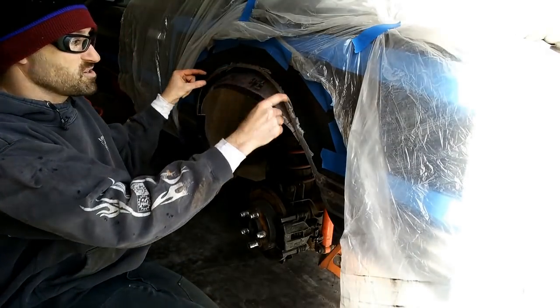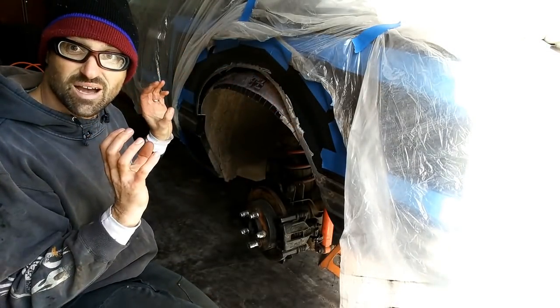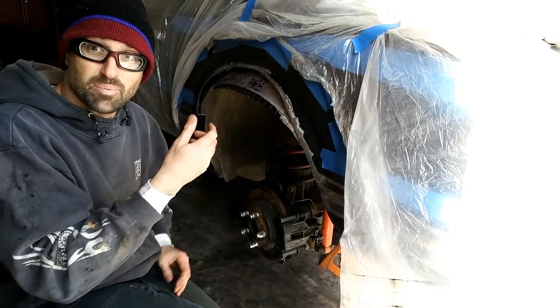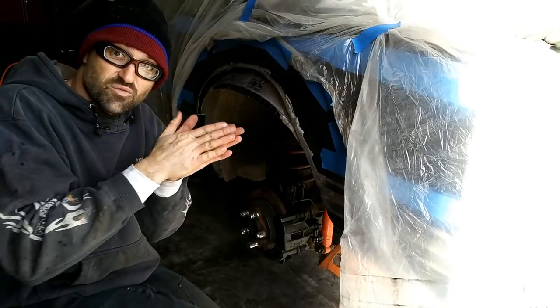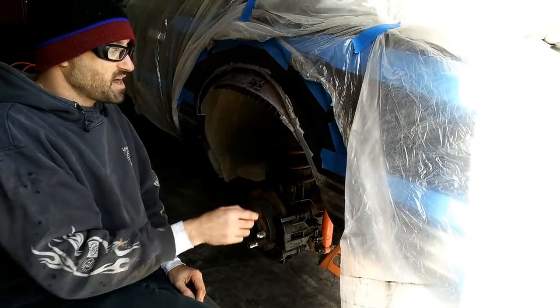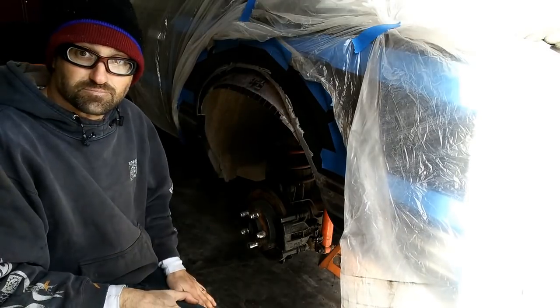You remember the pie cut that goes first, kind of the window that comes out. Next, you go in there and you take off the double lip where they both come together, basically the two folds come together and spot welded underneath. That next comes out, and then that leaves you with this.